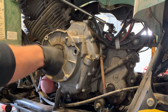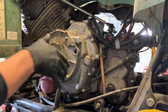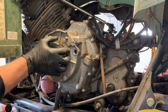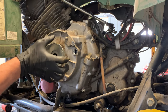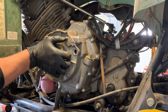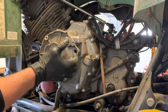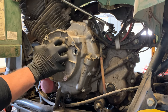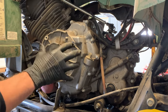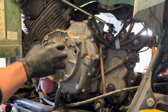If you have this recoil pull starter cup off and you try turning this over, you're not going to do a very good job of it. For lining up your top dead center mark, you turn this over. I want to warn you — this does catch sometimes, or because of the compression inside your motor, it'll actually jerk your hand. Be careful with or without rubber gloves that when you're turning this, you've got a firm grip so it doesn't fling out of your hands and tear them up. These are pretty sharp. I'll do a separate video on finding top dead center.